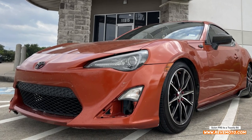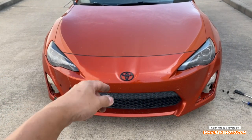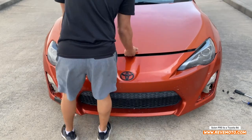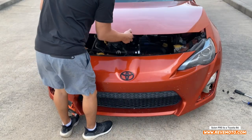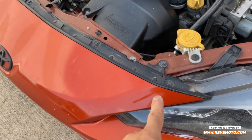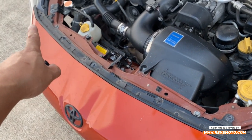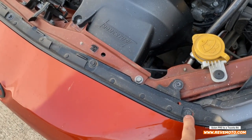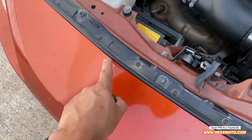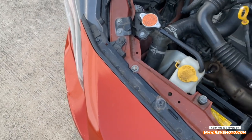Also the bumper is available if you guys want to stick to the FRS look. Alright, let's get it started. We're going to go ahead and pop open that hood. You guys can see running across the top part of the bumper, you're going to have these 10mm bolts right here, just running on top of the bumper. So take these off — all you need is a ratchet set with a 10mm on it.